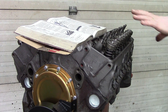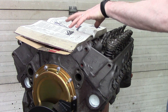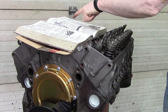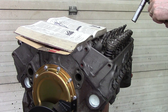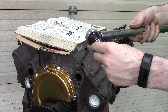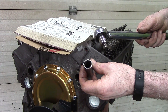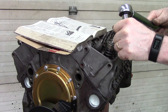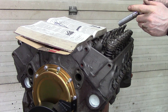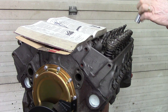So now I will torque this cylinder head in its place. The torque on this is 70 foot-pounds. I have my manual — which you can see is dirty on the edges from being used over the years — right here with my torque sequence right in front of me so I know what sequence to go in. I have a reducer adapter so that I can use my 1/2 inch torque wrench on my 3/8 socket deep well. I like that because it's a 6-point socket — I prefer 6-point over 12-point sockets; they don't tear up the heads of your bolts quite so much. I realize this extension throws my torque off a little bit, but I'm not that concerned about it.